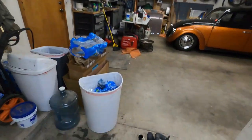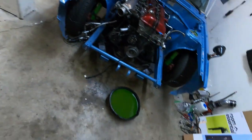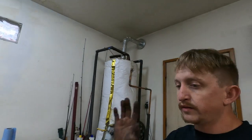It's actually a good thing I'm taking this out and replacing it because the manifold was leaking a little bit — I need to get that milled flat. The turbo was actually loose on the hot side, not sure why, maybe the clamp came loose. But I'm done for today — it's been a long day of work. I'll get on it tomorrow.